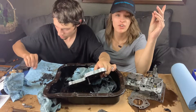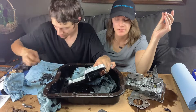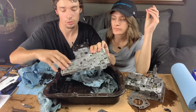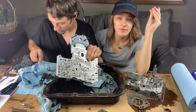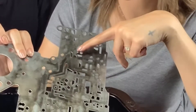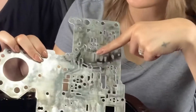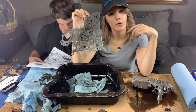Done. I don't know if the average guy is turning their automatic valve body into a manual. I mean, drilling holes into an expensive piece of your transmission is a little more than I'm personally comfortable with — but I'm doing it. DIY is cool until you realize how easy it is to mess up your stuff. Originally we would have needed to drill a hole right here, right here, and right here — but because we took that check ball out earlier in the video, we only need to drill right here and right here.